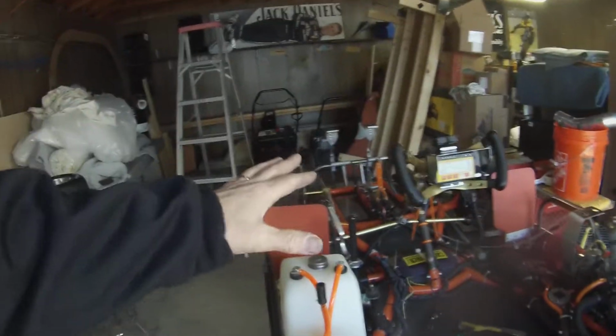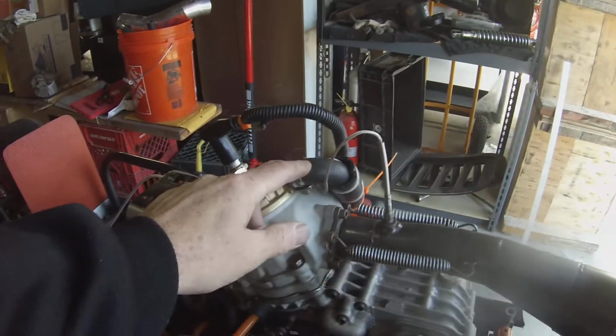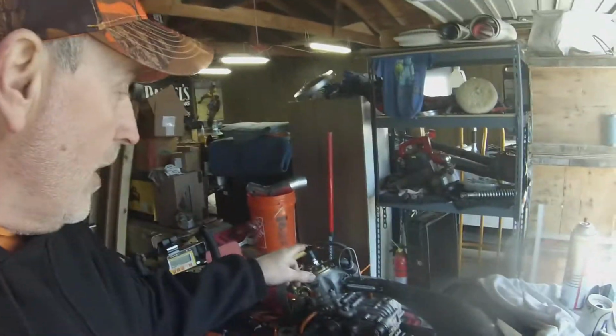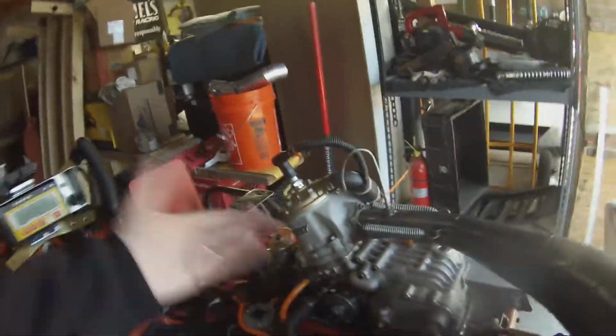If we still have this problem, the next thing we're going to do is make an aluminum elbow for here. And we're going to get one of those direct mount, liquid-filled dial gauges, a little one inch round face dial water temp gauge that'll go right into an aluminum elbow with a bung welded to it, so it's looking right at us. It's not as reactive as digital, but it's certainly not going to go up and down when you let on and off the gas.